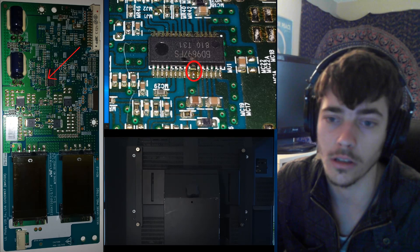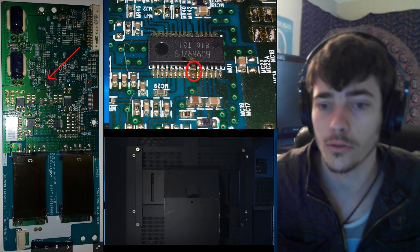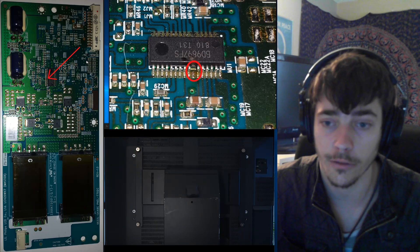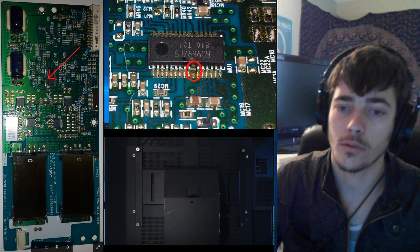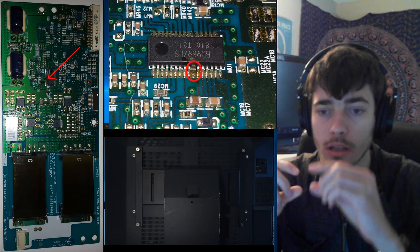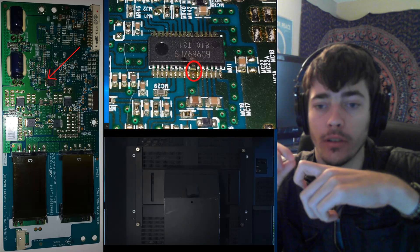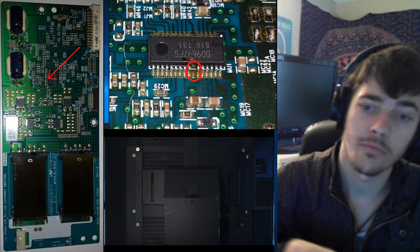The backlight itself is not defective — it's just this little board that controls it. To replace the board: there are four screws holding the shield on which also holds the board, so once the shield comes off the board will just be sitting there. It's got three plugs in my case. There was a group of wires here which I just jiggled and popped out. There was also a tiny white and blue ribbon cable — it's very delicate, so don't use any pliers; just shimmy it slowly with some finesse and eventually it'll fall right out. Finally, down at the bottom this one was held on by a little clip, so you just pop the clip with the tip of a small flathead screwdriver and it'll slide right out.